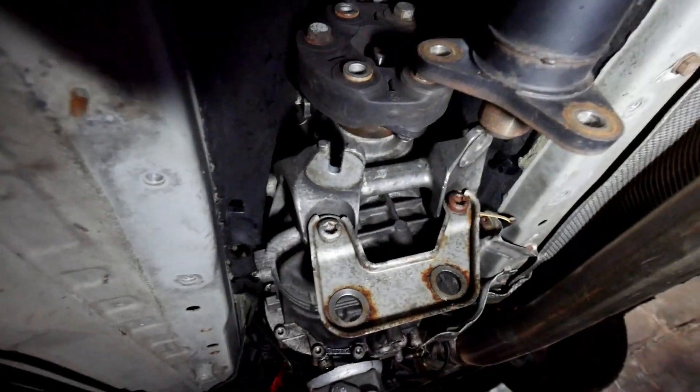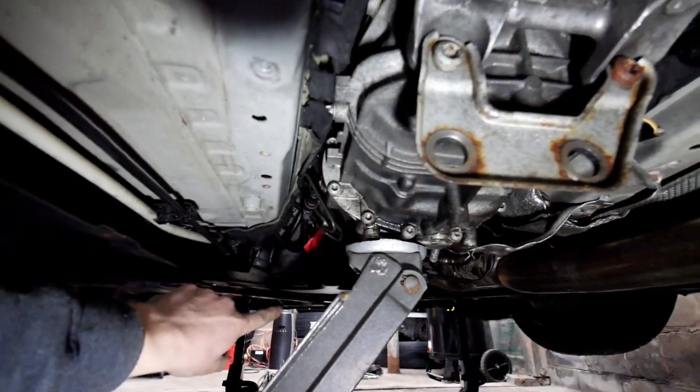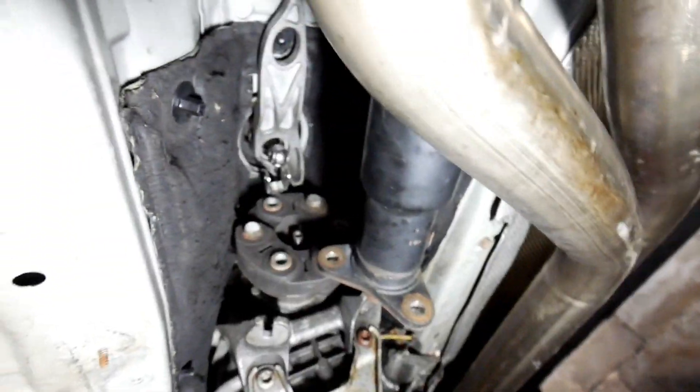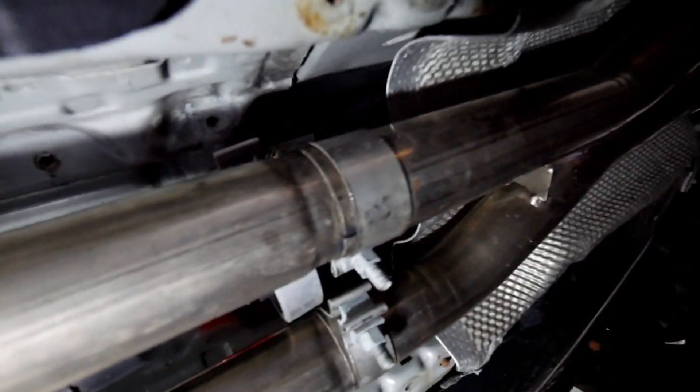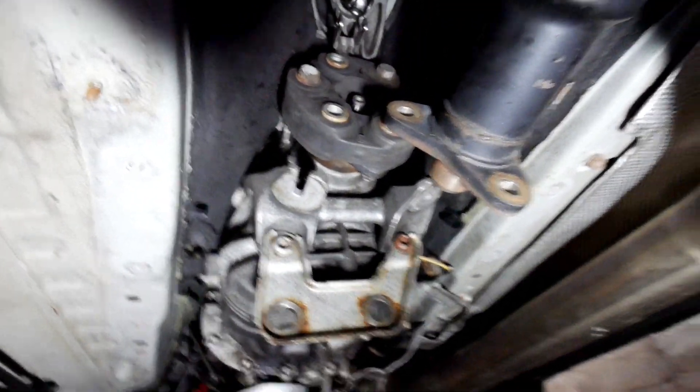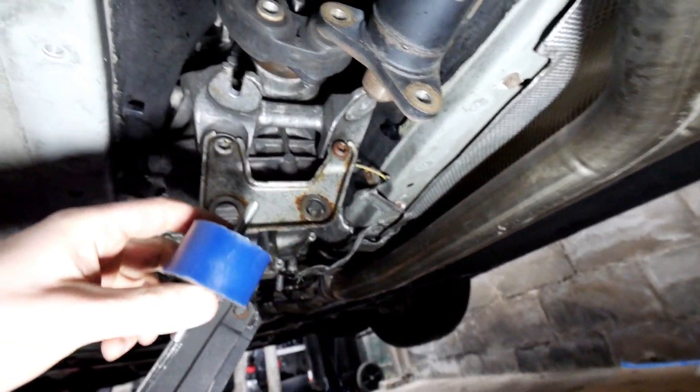Under the car, the plan is to remove the exhaust mid pipe area, drop the drive shaft, and take out the transmission motor mounts and bracket so the transmission can drop and they have room to put the new bracket in. They took off the drive shaft from the guibo, removed the center support bearing from the body, and took off the trans crossmember bracket.